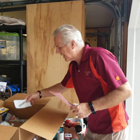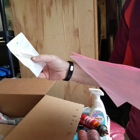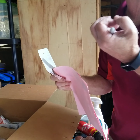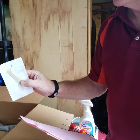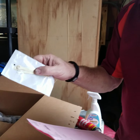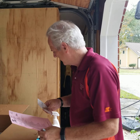Okay, so these actually, believe it or not, are the spark plug wires. Back when these Model A's were made, we think of spark plug wires as being black wires because they have the insulation around the wire. These were actually just a piece of metal. So that's all they are. Plug connectors, that's the spark plug wires. So you don't want to touch that while the engine's running or you will get a shock.